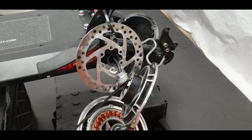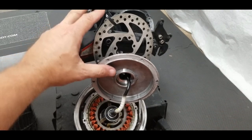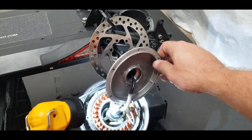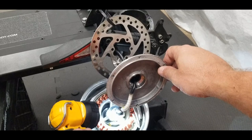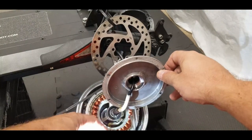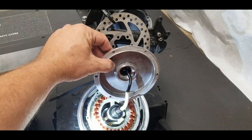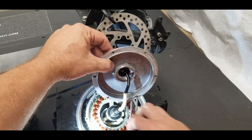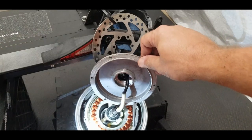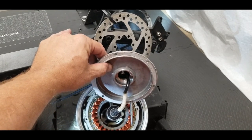You want to be mindful of that seal. And then from the housing, there's a bearing right here. That bearing is a 6202, I think, or 6022 — it's a Chinese bearing and it's a pretty cheap bearing. A lot of times those bearings go bad, and when they go bad they get flat spots on them and you'll hear like marbles rolling around in the bearing. So that's one thing — if you're hearing some unusual noises coming from your motor, that could be one of the reasons why. You can take this bearing off. There's also another bearing inside on the other side, and you can replace them with higher quality bearings if they do go out on you.